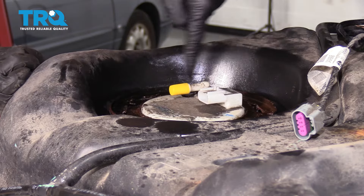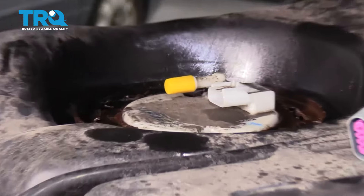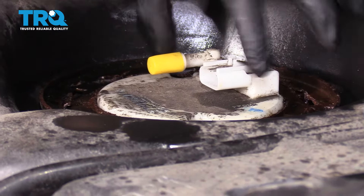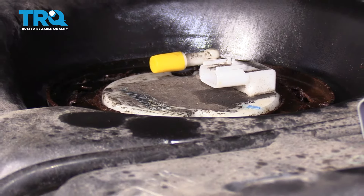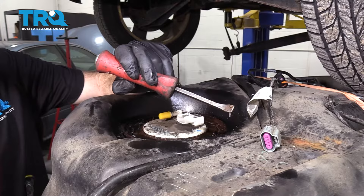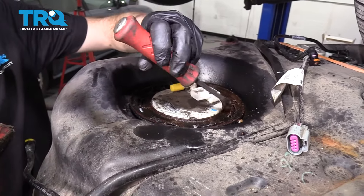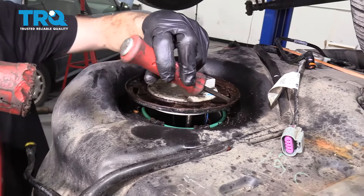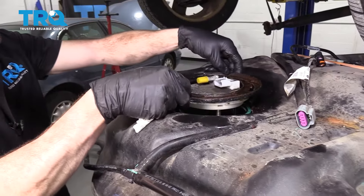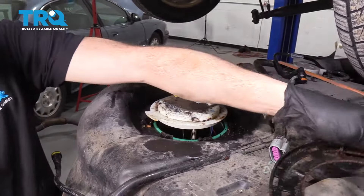Now start removing the locking ring. The ring has a bunch of slots, and right next to those slots are tabs attached to the fuel tank. Line up the slots with the tabs and turn the ring counterclockwise to remove it. To break it free, typically use a brass punch — something that won't make a spark. On this one a pry bar works, put a little grease on it so you don't make a metal-to-metal spark, and use a rubber mallet to give it a little bonk until it breaks free. Have a collection bucket on the floor near the fuel tank. Grab the ring, inspect it to make sure it's still solid and reusable — this one is extra solid, so set it aside.